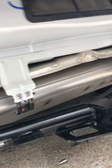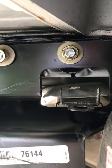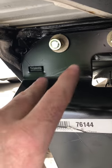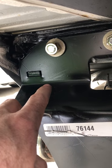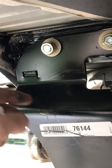I painted it because I did start cutting into it, but I knew better than to hack this brand new car apart. I had to make this video because people are reading your directions and hacking into their car when it's completely the wrong thing to do. Maybe update your directions — whoever wrote them — because it's dangerous. This thing is designed to have three bolts. You go hacking a hole in it and you're creating a tear point. You put a slice in it, you weaken the metal — that's where it's going to start tearing, especially with the plate in there.